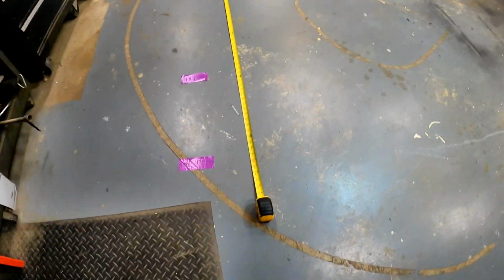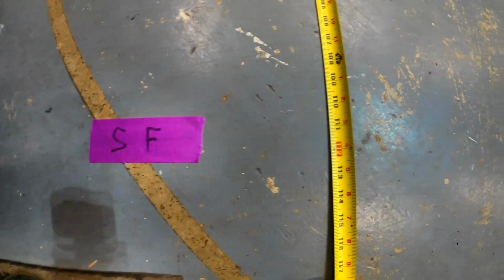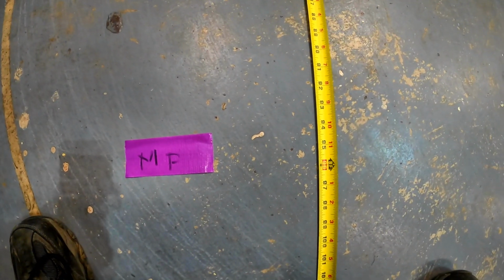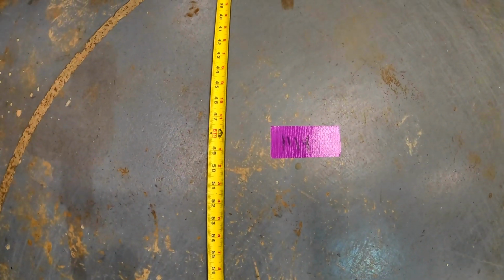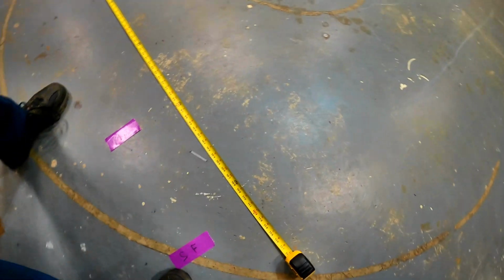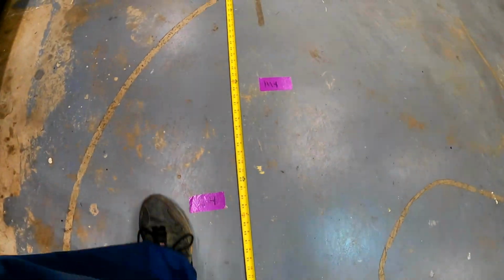I mean, that's impressive. So to help show the scale here of what we're talking about, stock front tires only 112 inches, goes down to around 96, 95 modified. Stock with four-wheel steering is all the way to 62, modified is 48. So we literally go from completely stock vehicle at 112, modified with four-wheel steering 48, like a third of the radius. That is crazy how good that is.